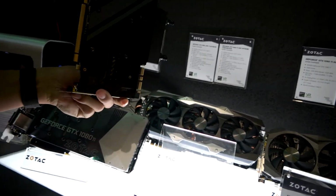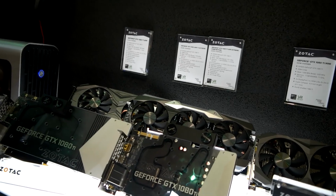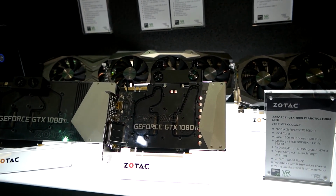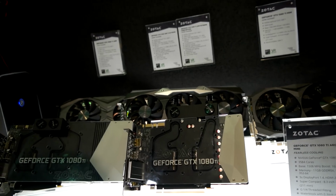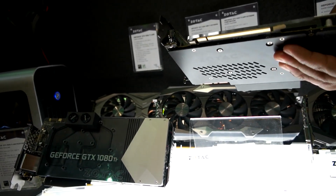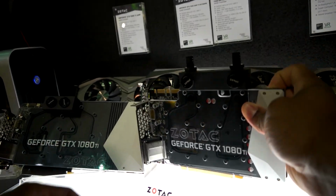And basically, I'm assuming, hey, you can run SLI on these. Definitely. Basically, two-way SLI with an SLI high bandwidth bridge as well. And because these are water cooled, and you don't need a fan on there, what's the power draw on this? I'm assuming, let's see, minimum power draw is going to be about 250 watts. Oh, okay. That's the minimum for any 1080 Ti.